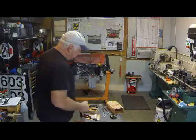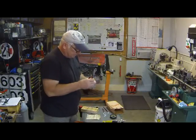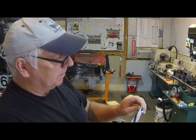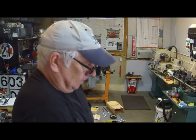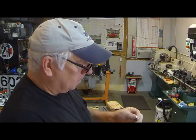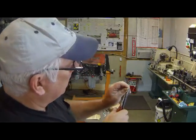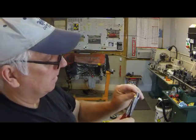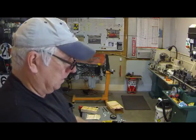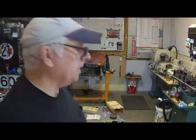We'll see how effective both of these are in trimming the sides of this small rivet. And we're not going to have to remove very much material. What I'm going to do is simply just try to... it's very soft, actually. And what we want to do is make that as parallel as possible. I don't know if you can see that. But let's see if we can reduce that a little bit. So, yeah, what we need is more of a rectangular shape to fit inside the groove.